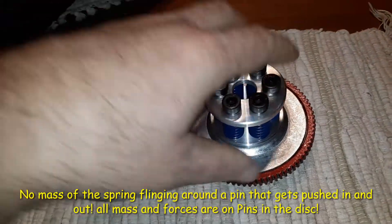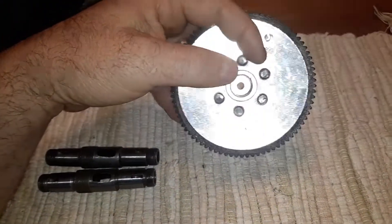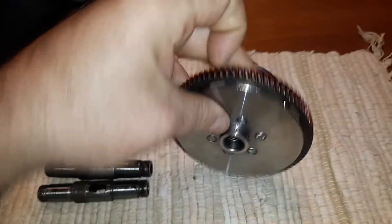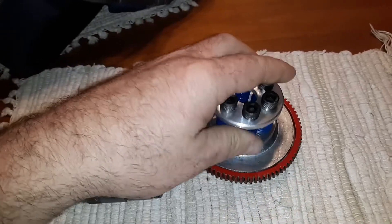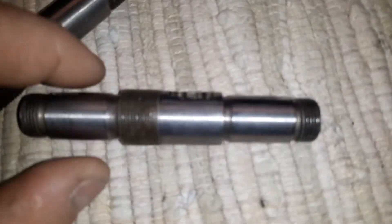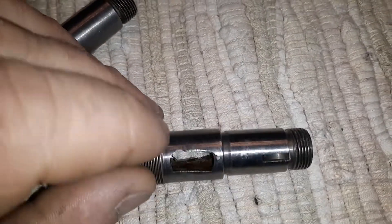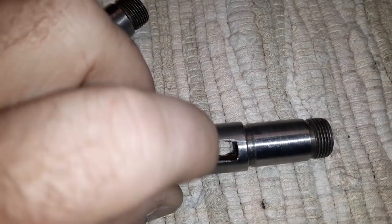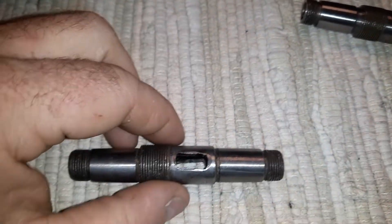This is a simplified representation, but it's going to show the point. The pin will go straight through this shaft and push on that plate. There's a nut that goes inside to lock it all together, and it'll push these springs in and out a little bit to release and grab. Every time I had the spring kits, I had this issue — the pin will just destroy these things. I guess it's the mass, but they always kept cracking all the time.